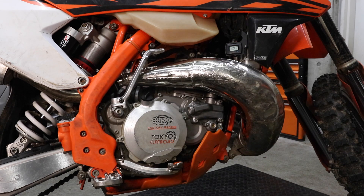In this series of videos I'm going to be overhauling the bottom end of my 2017 KTM 250 EXC. The bike has done 456 hours, still runs great, but I decided it's a good interval to do some preventative maintenance and overhaul the bottom end, including changing out all the bearings and also putting a new conrod in the crankshaft. You'll be able to follow step by step — I'll share any information regarding special tools and also tips and tricks.